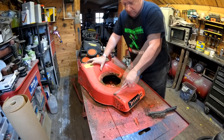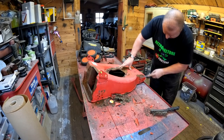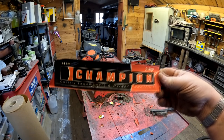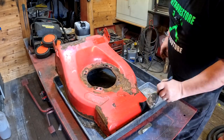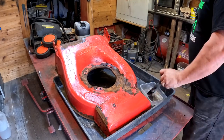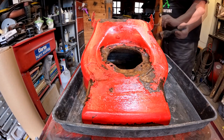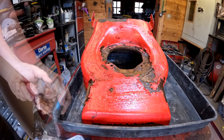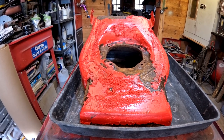As you can see, I'm just scraping off the last bit of the flaky paint now — it really does come off easy. As I say, these haven't got any primer or extra primer on them at all. This is the stuff I use — this is a Power Strip paint stripper; it's probably one of the stronger ones on the market. Things like Nitromors are nowhere near as strong as they used to be. I just paint it on liberally, and sometimes you have to go over it a couple of times, but in reality it probably won't get it all off — but that doesn't really bother me in this case.